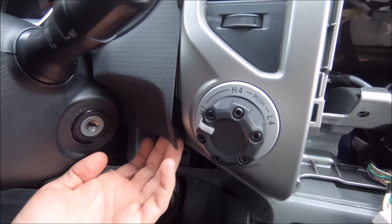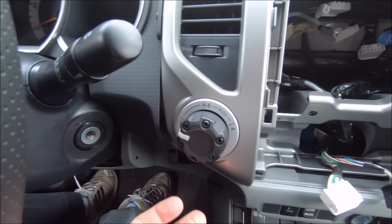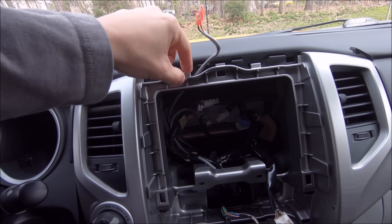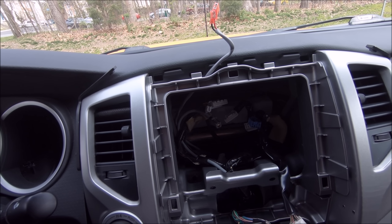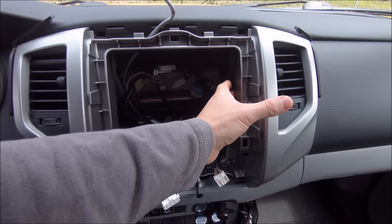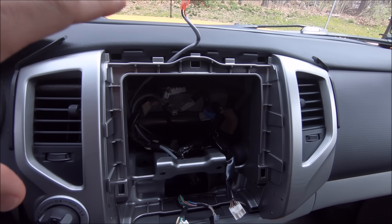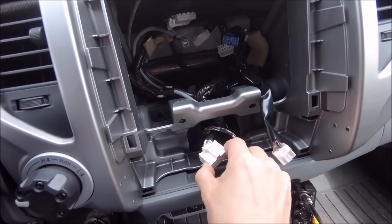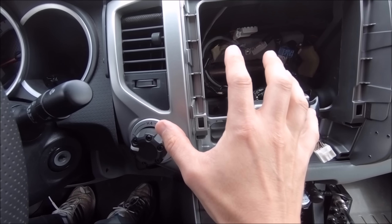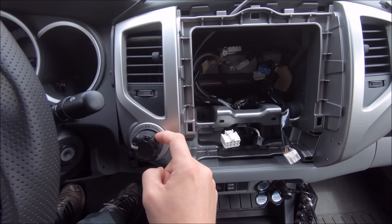When you get about this much clearance on the plastic, that should be good to remove the center console. I actually have a wire running up here for the 2T-PAM, so I need to be aware of that when I pull this out — but you guys won't have that unless you have the 2T-PAM as well. To get the center console part out, just take one hand on each side and pull it out. It is just tabs along the top line holding this in. Tuck all the wires back in so none of those get snagged. If you are a 4x4 Tacoma, this is still plugged in, so when you get this loose, go ahead and disconnect the back of the 4x4 switch.